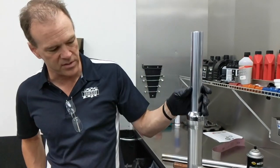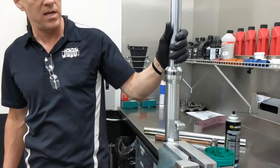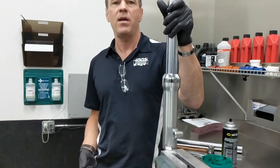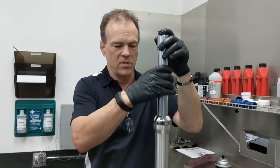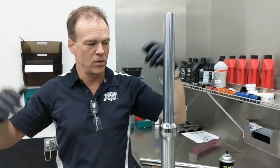The other possibility for trouble is if something really impacted your lower fork leg — if it's got a dent in it, when the bushings come by, it won't want to pass. So you're going to check this to see that it strokes freely — nice and free. In theory it should almost drop against the grease nicely by itself. So this fork's in perfect shape.